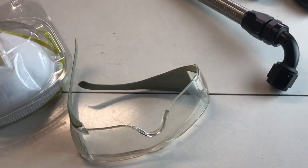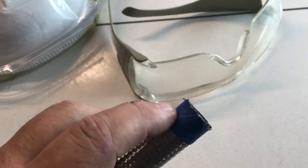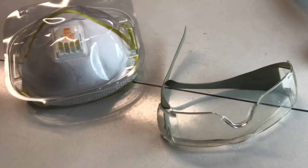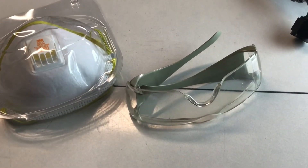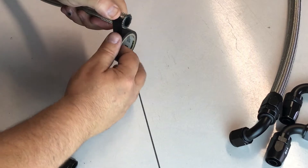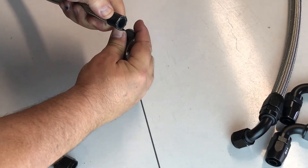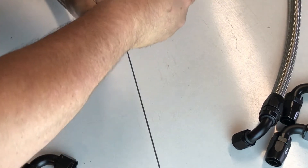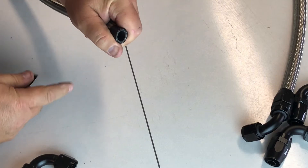When I cut that end I wanted to show you what I was wearing: I was wearing a respirator because you get fumes off the rubber, and I was wearing goggles to make sure any metal coming off of this doesn't get in your eyes. So make sure you're wearing the right safety equipment — respirator and definitely wear some goggles. Harbor Freight also makes a really cool full face mask that'll work good too. Let's get this wrapped with some electrical tape and then get the end on. When you're doing this, you don't want to put too many layers on but you want to keep it tight — real tight. If you put too many layers on it won't work; the tape will be too thick for the fitting to get over.